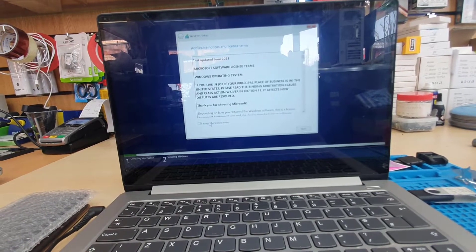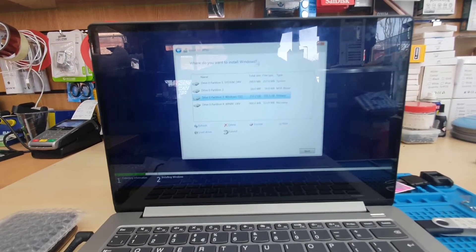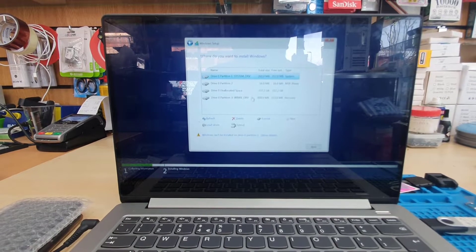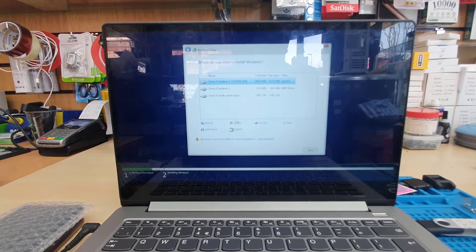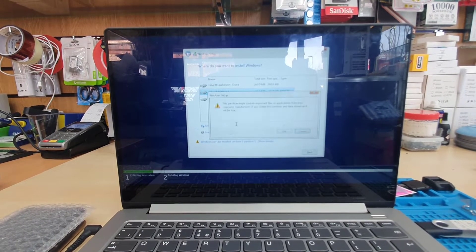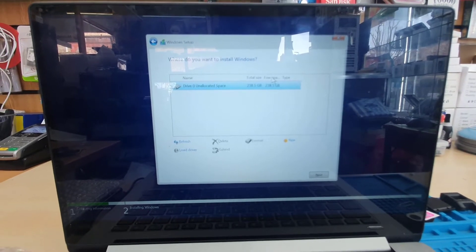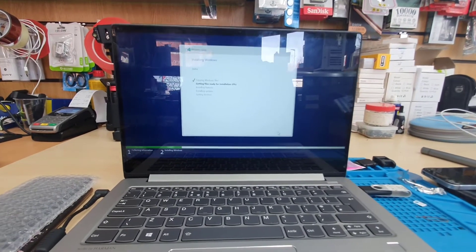As you can see, this is quite simple. Follow the on-screen instructions. If you want to do a clean installation, choose that option. Before you delete any partition, make sure you've backed up your data — otherwise you're going to lose everything. I'm going to delete every single partition for a clean install, make a single partition, click next, and it will install all the necessary files and folders. It takes about 15 minutes to get the setup done for Windows 10.